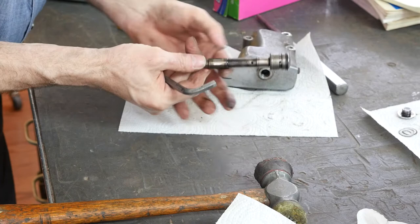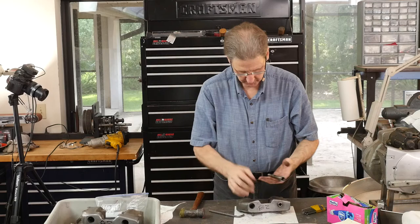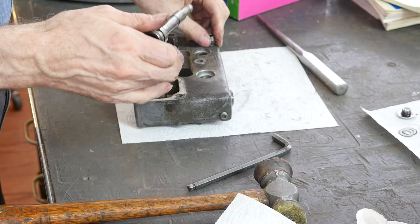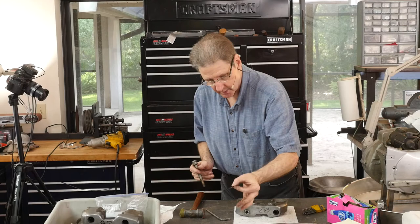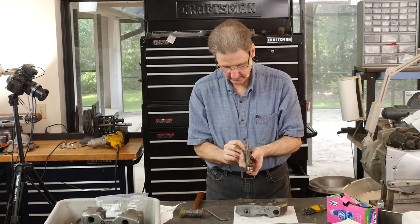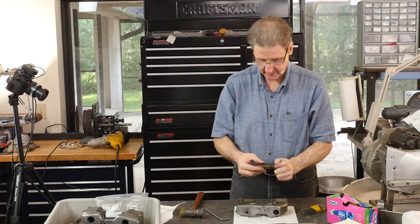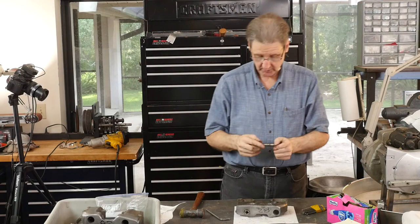This is the intake side — there's a spring and the washer. This is the oil passage. You can kind of get an idea — is it nice and tight? The coolest thing would be to pressurize this with oil and watch how much leaks out the ends. It can cause slop that won't be best for valve timing, and valve timing is so crazy in these old Sportsters. The thickness of the gaskets changes the angles. This feels pretty good — all this will be usable.